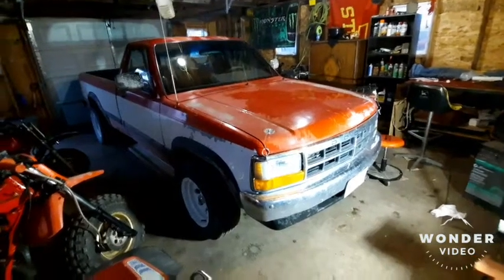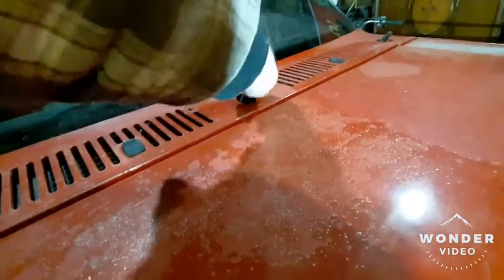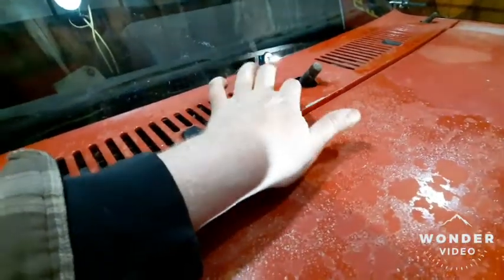We've got our first vehicle in the garage. Out of all of them, of course, it's the Dodge Dakota. Basically, what happened today is my wipers quit working on me. I can just move these guys all willy-nilly by themselves now. What I'm assuming it is, is there's a plastic bushing in there. Those are known to break, and then that happens.